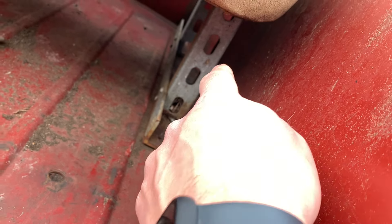Just bear with me — this is going to be a slow-going process. The cool thing about this Jeep is it's got a title in my name and it has all the drivetrain. It's a 258 straight six. It even has antifreeze and decent oil in it. It has a T15 3-speed, Dana 20, manual steering, and manual brakes. We're going to change that to power steering and power brakes to make it more fun to drive. It would be fun to put a four-speed or maybe a T5 behind this just so we have that extra gear. I've got a tune-up kit for it: spark plugs, points, condenser, coil, new rotor — all that good stuff. Tune in for a later video and we'll get this thing up and running.